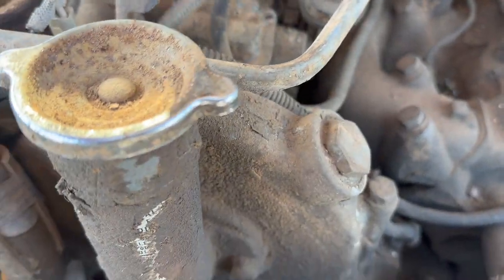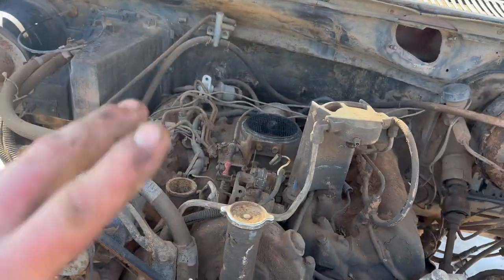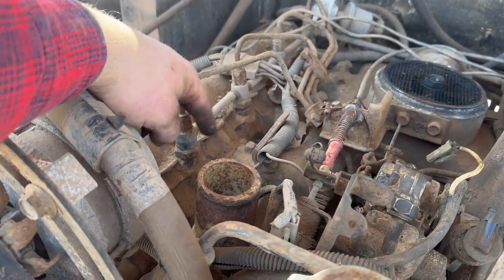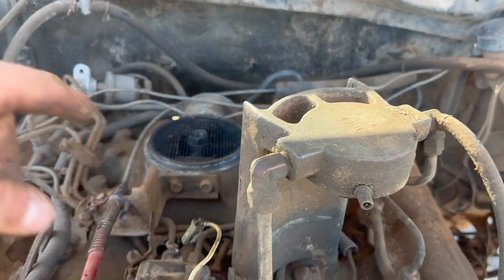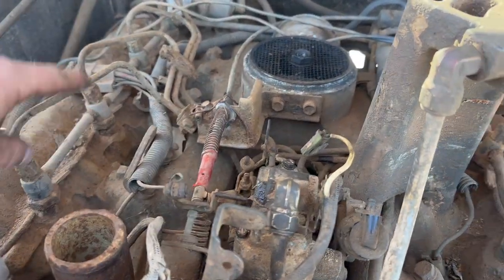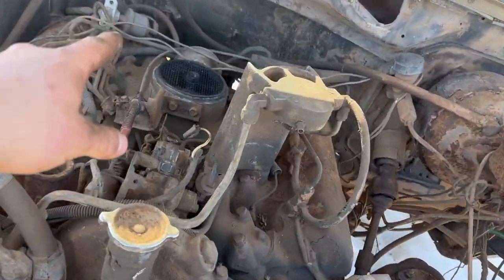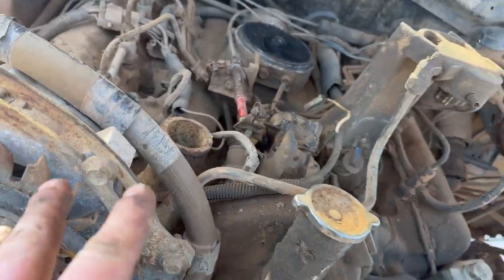What we're going to do, we're going to pull these guys off because we don't want the pump to engage. That's not our goal here. One would say in order to do this right, pull each injector, squirt a whole bunch of transmission fluid in it, roll it over, coat the entire cylinders, and then start going. We're not going to do that, because I know if we touch these guys, they're going to break, and we don't have spares. So we're not going to deal with that at all. It's just going to have to pull through. But we will squirt some WD-40 right down its intake, turning it over just to help her out a little bit.